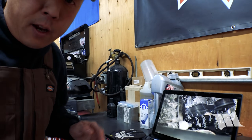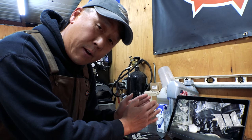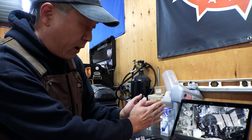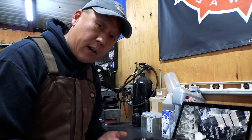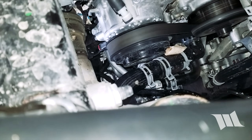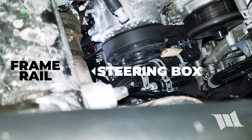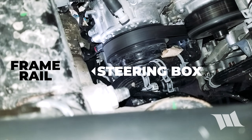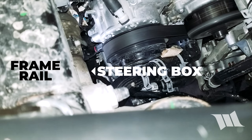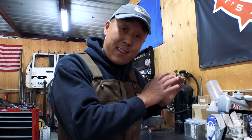So check it out. Double Tap Daddy over on WayofLife.com sent me this video clip, and in it you can actually see his steering box pulling away from his JL Wrangler's frame rail in and out as he turns the steering wheel left and right. You can see here — this is the frame rail and this is the steering box — the steering shaft going round and round, and if you look real closely, you can see that the steering box is moving in and out, ever so slightly. I can't tell you whether or not something like this could cause death wobble, but what I can tell you is that this can't be helping anything.